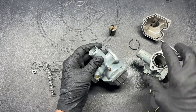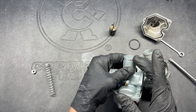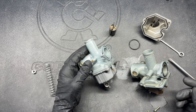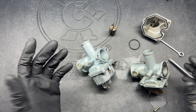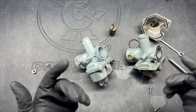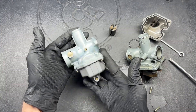There was one other thing I noticed besides the idle screws: I didn't really love the threading on the aftermarket one for the top plate. It was just a little bit looser and didn't feel like it was biting as hard — the threads weren't cut quite as nicely. But other than that, once I filed down that brass plug, I couldn't tell the difference in how these ran, no matter which jets I put in which carb body. I was really impressed with it overall. There's no reason why I wouldn't be running this aftermarket carb on this bike.